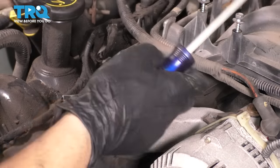All right, let's fish them all out. They do have washers on them, keep that in mind. So take the washers off as well. And don't save these, don't reuse them. These are torque to yield bolts, so they need to be thrown out. Oh yeah, also we're gonna make a mess now. I'm gonna take out these bottom ones first.